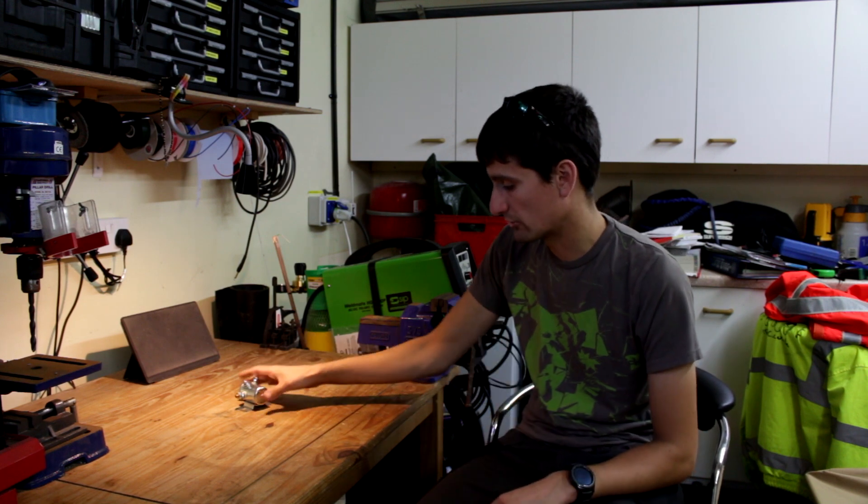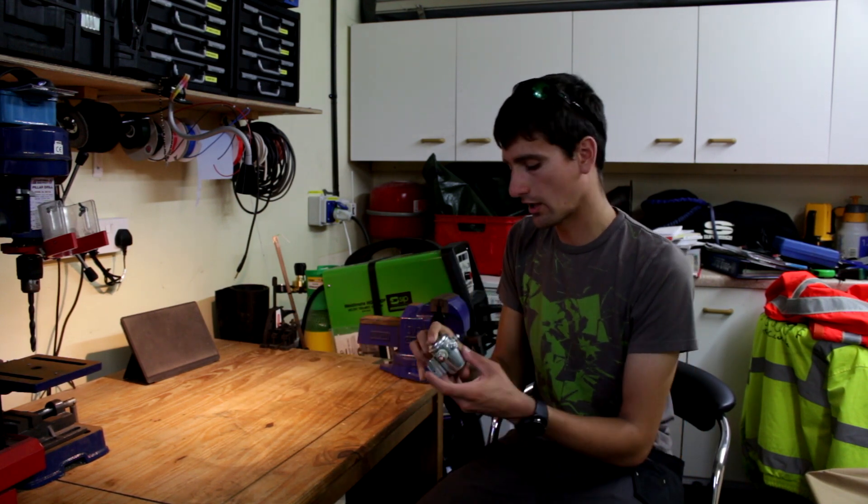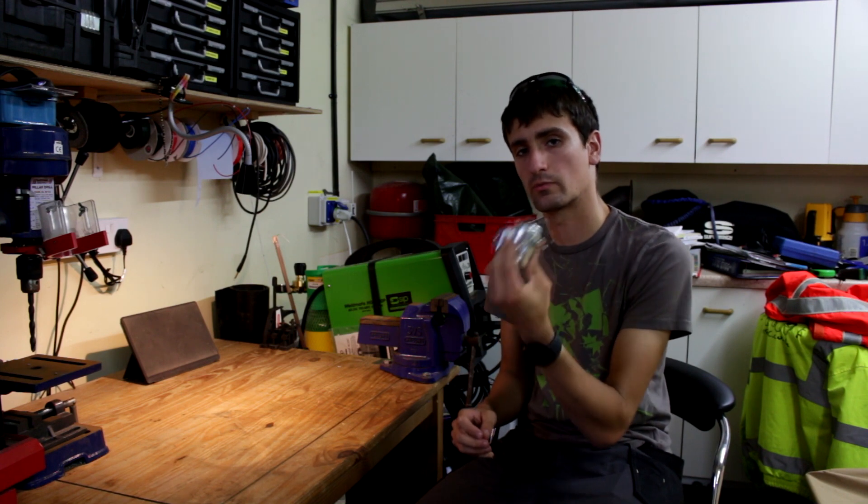The main pro of this one is they're cheap and relatively easy to source, even in quite remote areas of the world — it's literally just a bog-standard 12-volt solenoid, so you've got a much better chance of finding one in the middle of Africa, for example. Another advantage is it's very easy to wire in a manual override, which allows you to join the starter and auxiliary battery banks together in the event your starter battery is flat — effectively jumpstarting yourself with the push of a button.